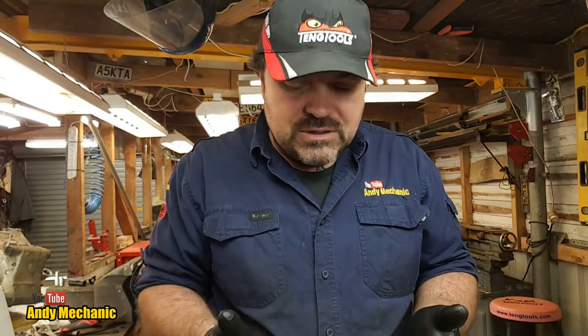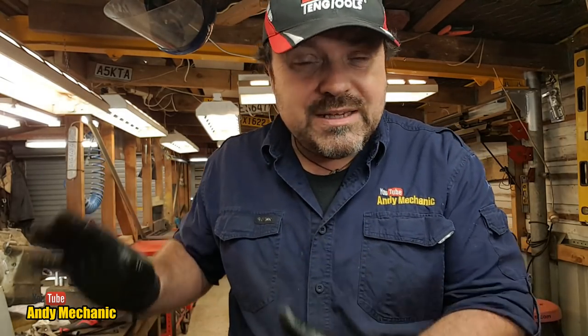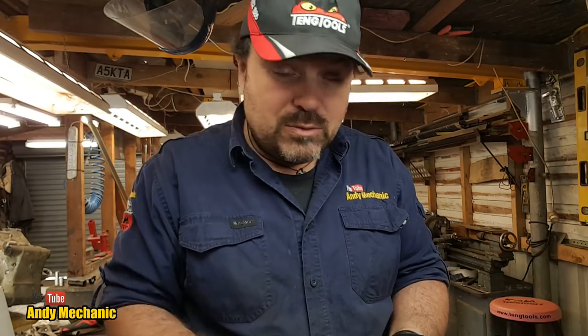Right then, crew, a bit of bonus footage for you. I could not sleep last night. I really couldn't. I kept waking up thinking, what's really going on with this transmission? The customer complaint was it only drove in super low, not high and not low. That has to be a clue, because even if there was some drive through the clutch packs, and we've inspected them now and they seem fine, certainly serviceable, there would have been some drive. It wouldn't have been zero drive.